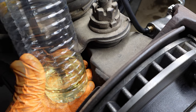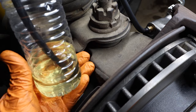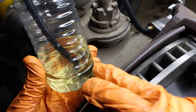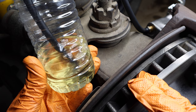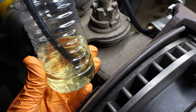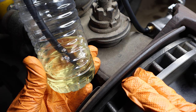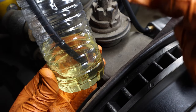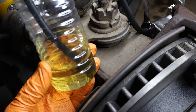Push the brake pedal all the way down. Let all the air come out — you can see gravity is actually working and air bubbles are coming out in the brake fluid. When the pedal goes back up, instead of sucking in air it will suck in the fluid from the bottle. Press the brake pedal all the way down — see all that air — then let it go back up. Repeat this process as many times as it takes until there are no more air bubbles coming out. If your master cylinder goes all the way down, do the right rear first, then the left rear, then the passenger front, then the driver front. Once satisfied, tighten the bleed screw line.